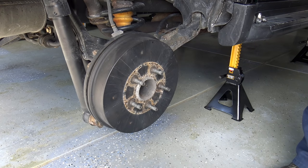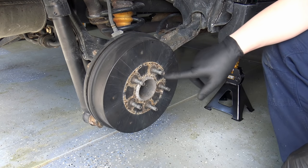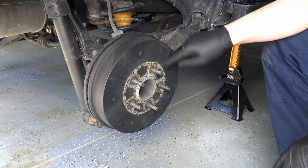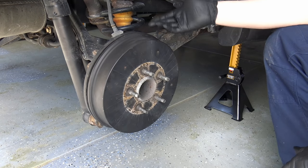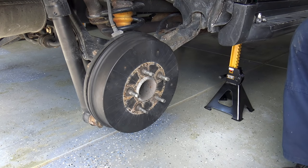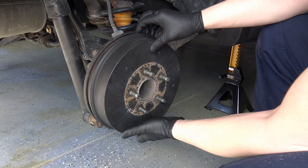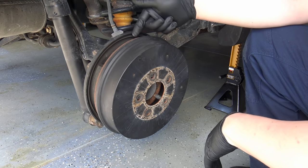While the drums are drying, go ahead and jack the vehicle up and get the tire off — they're 19mm lugs. Make sure you have a quality jack stand under the pinch weld to support the vehicle safely. These drums will stick at the hub center but generally don't stick on the shoes. Same as a rotor, give it a hit and it'll break free. There'll be a lot of brake dust coming out of here.